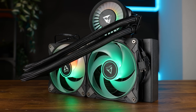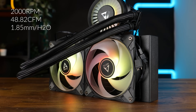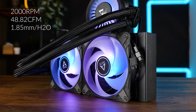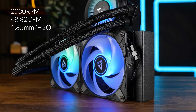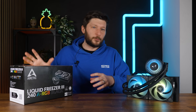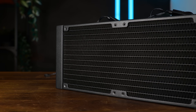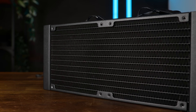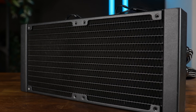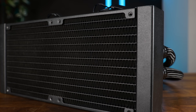The LF3 is definitely something special. We got the 38mm thick radiator with two up-to-2,000 RPM P12 ARGBs, which can push up to 48.82 CFM at up to 1.85mm of H2O static pressure. Compared to the previous generation Liquid Freezer 2, Arctic came up with new stuff — the Gen 3 rads are now one FPI denser at 15, and the fins themselves go deeper into the block, so you have more cooling area.